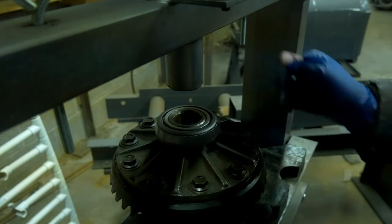Last thing we've got to do is put the gasket and the cover on. For this, I absolutely wholeheartedly recommend the use of RTV. I use Permatex Optimum 27037. After making sure the diff cover and the diff case area are properly cleaned, I just clean it up with that little 3-inch Roloc bristle brush like I do with everything else, and then we're off to the races,